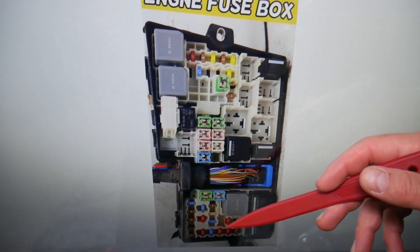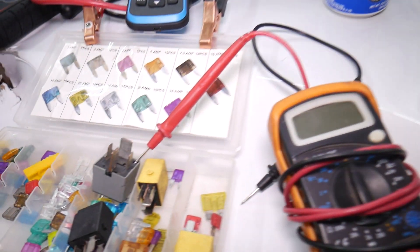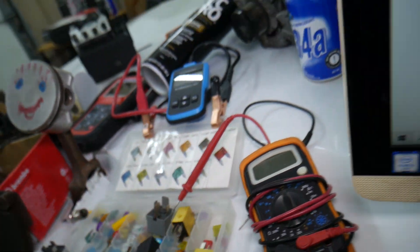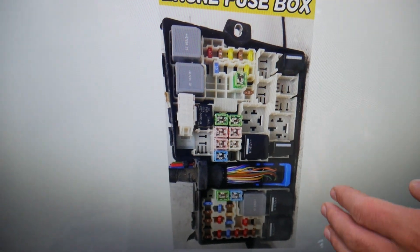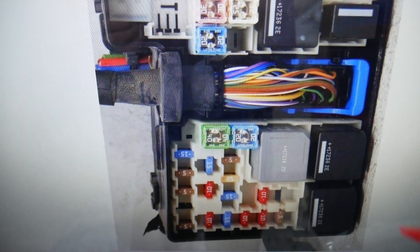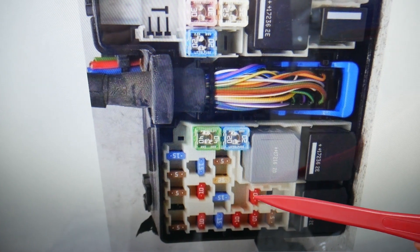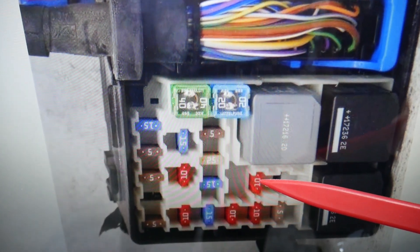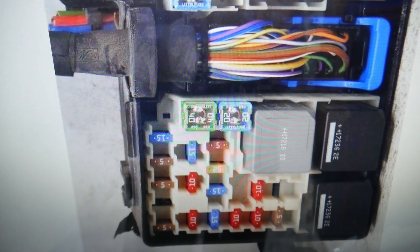Rear view camera fuses — where you can expect to find them. One fuse in the engine fuse box, and two more in a different fuse box. If you need to buy any fuses, relays, or parts at a good price with quick shipping, we'll put a link in the description below. Coming to the engine fuse box, what we need to check right here is fuse number 28 — that 10-amp fuse — that's the one you will need to check.